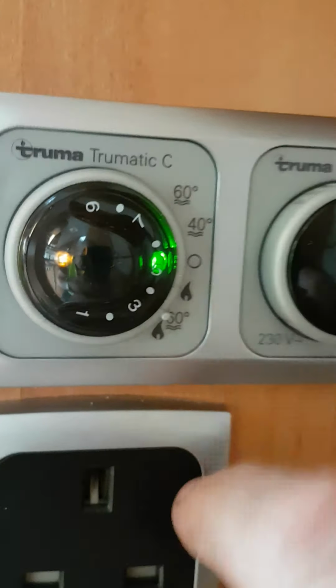So any time that you have any problems with water pressure on any of your taps, always just have a look at this wee valve and make sure it's up. Because once that goes down, you're depressurizing the whole system. So if you open your hot tap, the cold tap will always really pump because it's directly from the tank, but the hot one will come through this valve here. And if you open your hot tap at any stage and you're getting air coming out or it's not looking too good, have a wee look at this valve and make sure it's up.